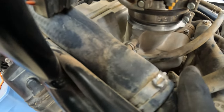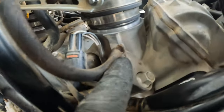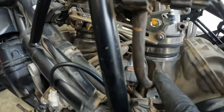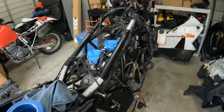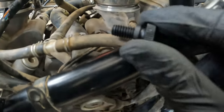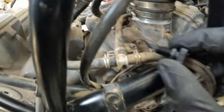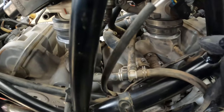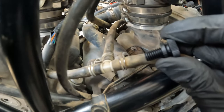You can route them through here. The ones you do not want to touch — on the left side it's the one that goes to the map sensor, leave that intact. And then on the right side, leave this one intact as well — that goes to the map sensor on the right side. The only ones you want to touch are the ones at the T: the front left and the rear right. If you're doing Stage 2, you can cap off at the T using this cap, which screws right in.